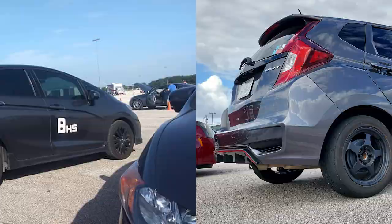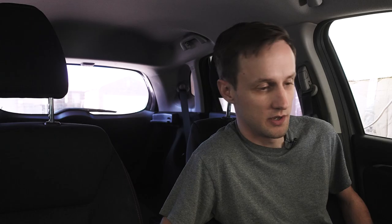For the suspension, I went from stock to HFP to Redshift suspension. Stock suspension is not great for autocross, not great for track days. It's really just too soft — the spring rates are not enough to handle putting the grippy tires underneath them. It's fine if you want to carve some back roads, but if you're getting into autocross or track racing and really trying to cut time down, the stock suspension is working against you in every way.